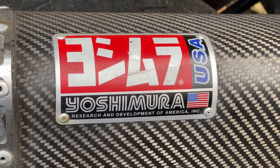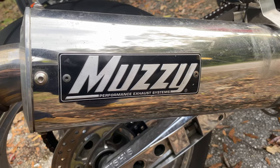The first thing that I would say is go full bolt on. Like with cars, you normally hear people talking about full bolt on. Basically, which incorporates on a car, a throttle body, an intake, and an exhaust. On a sports bike, for instance, it would be exhaust, air filter, velocity stacks, and a dyno tune. This is probably the first and most crucial step to making your bike fast, because it's not tearing apart the motor and it's not adding any power adders.